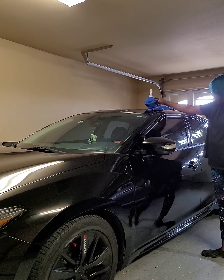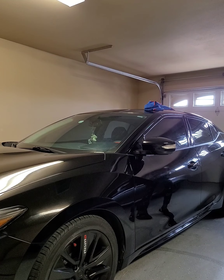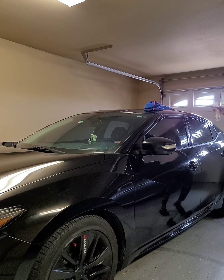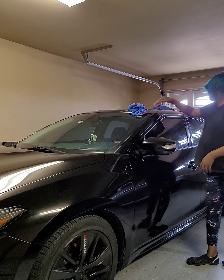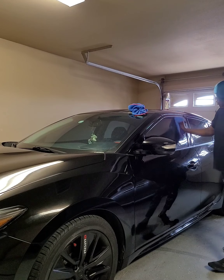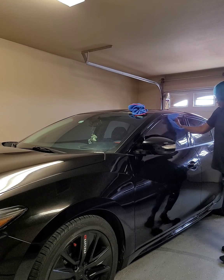If you have hyper dip or plastic dip on your car, don't spray the Torque directly on it. That section got the side-to-side. I need to pick another surface — let's do this window. The window needs the side-to-side, and now I can circle the previously sprayed area. If you see little swirls or smudges it just means you haven't wiped it in enough. When you do the circles you can put a little bit more pressure. Don't worry if a small amount gets on hyper dip — you just don't want a lot.